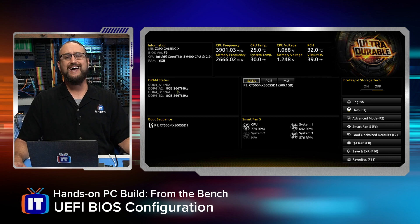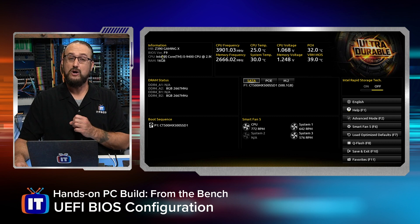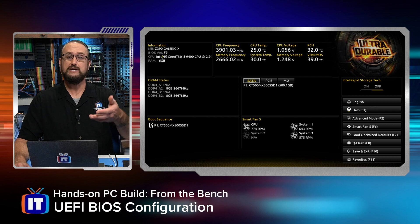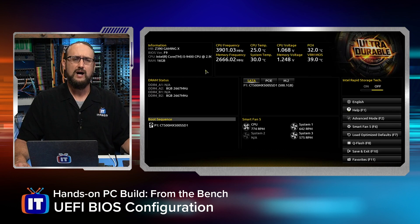Notice that it's telling me what the BIOS version is. In this easy mode interface it's not giving us enough information, so what I want to do is switch over to advanced mode to glean a little more detail from the UEFI BIOS interface. We can do that a couple of different ways — this has a nice point-and-click menu, or I could just push F2 on my keyboard. This is one of the reasons we have the wired keyboard here, since USB interfaces are typically recognized by your firmware platform without an operating system installed.